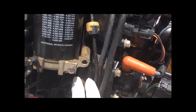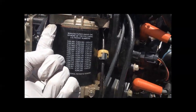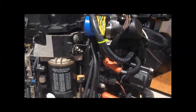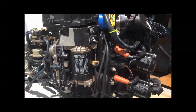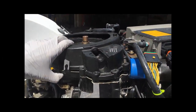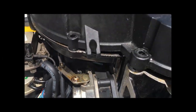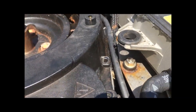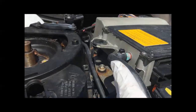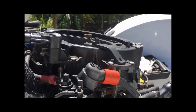I've removed the mounting bolts, the positive starter cable, the lower mounting bolts, and the two upper mounting bolts, and it still doesn't want to come out. I thought it was another bolt inside, but doing some research I don't think there is. So let's take the cover off anyway — there's a whole bunch of retaining bolts all the way around the perimeter. To get to the last two, you have to pull the EMM off, so that's been loosened and slid backwards. Now we're getting the flywheel cover off.